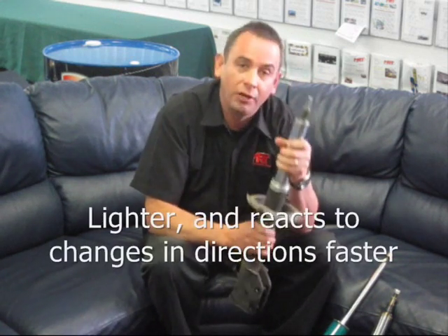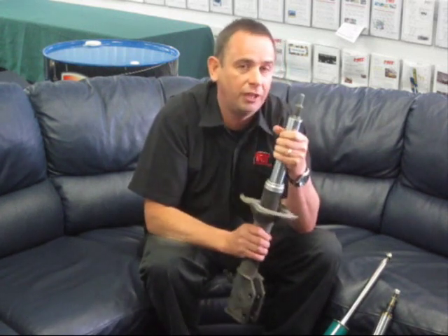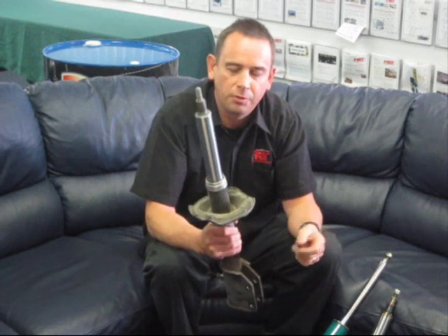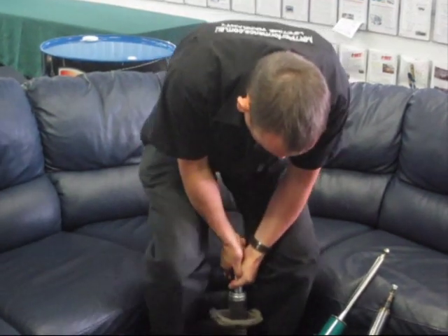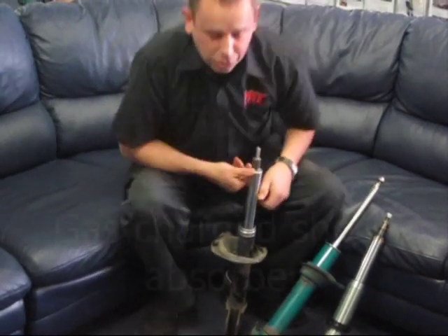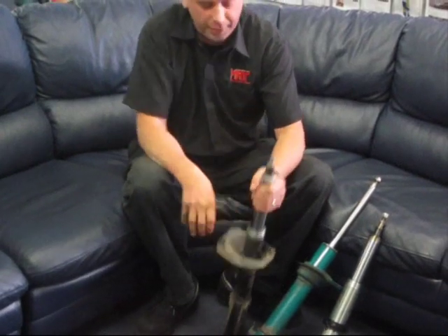The lighter part now moves up and down with the suspension, so it's able to react quicker to bumps and changes of direction. The point of this video is to explain a stiction problem that happens in the design of some of these shock absorbers — particularly on the Subaru rear suspension. The shock absorber travels up and down, and because it's a gas-charged unit, the gas forces it back to its fully extended rate.